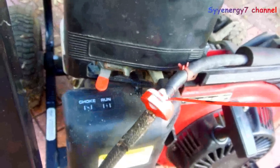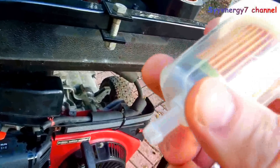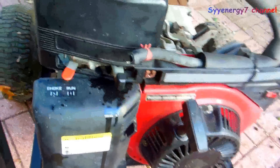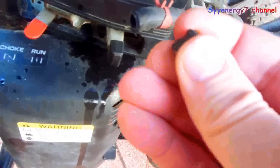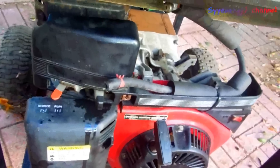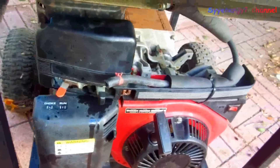Pull it off easy. The inline filter — no problem, easy — and it's got the direction marked on it. The other thing is, if you're reusing the old hose, I always use old stuff if it's still good. The part that gets most screwed up is the end — that's the part that was under compression. When I install a hose I always give it a little more length because I can always cut the end off; that's usually the spot that gets screwed up.